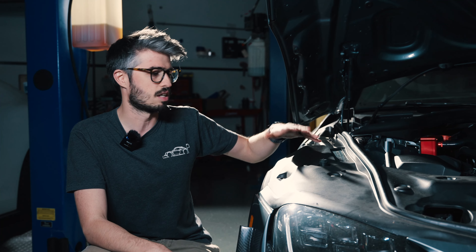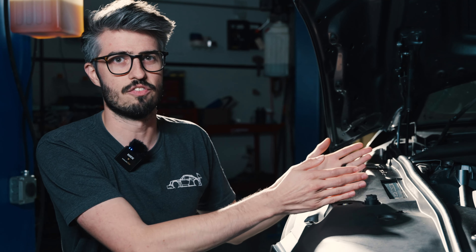There are several companies that offer a fender vent for the Supra through the top of the hood, since the fender and hood are kind of all one component. All of the offerings I've seen so far cut this section of the fender out and then allow that high pressure air to escape through louvers in the top surface of the hood. One of the problems with this is that you get rocks flying into your engine bay and getting stuck under the reinforcement on the underside of the hood and rattling around. The other issue is that it just doesn't look very clean when you pop your hood.